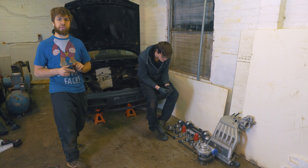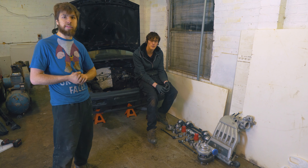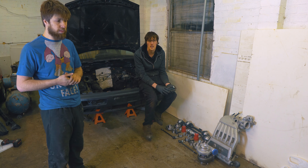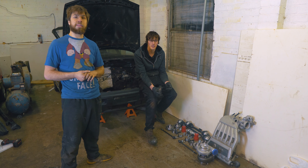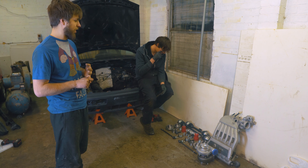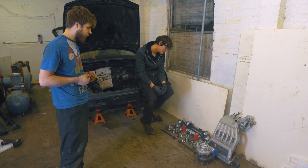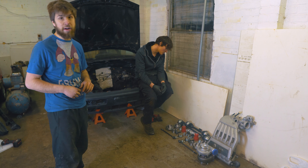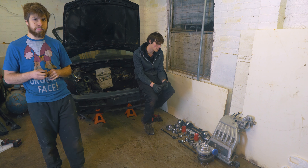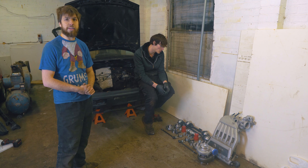When we first got the car back and had a look at some bits, there was something like a track rod end and that was all — it was horrible. One of the wheel bearings had collapsed, and someone had put a standard four-stud non-wide-track front hub on it, so the track is massively out and it's got the wrong stud pattern on one side. So I've ended up buying quite a lot of stuff — front and rear hubs and bearings, new branded driveshafts, branded track rod ends, inners and outers, ball joints, rear axle bushes, converting to a Mk4 Golf-style rear wheel bearing instead of the standard Mk3 taper fit, just for ease.